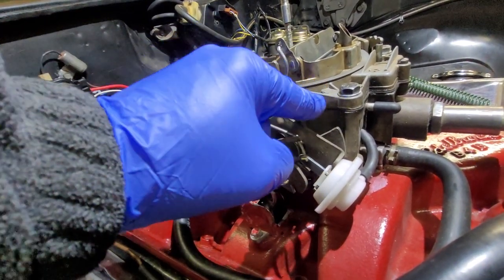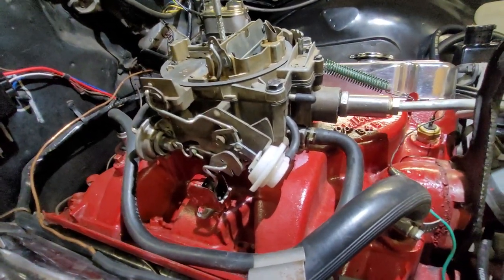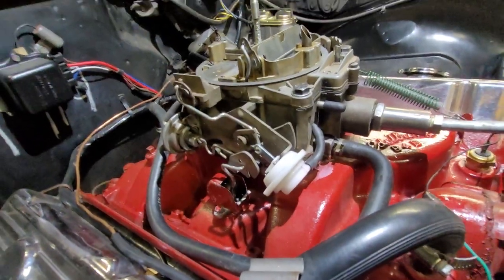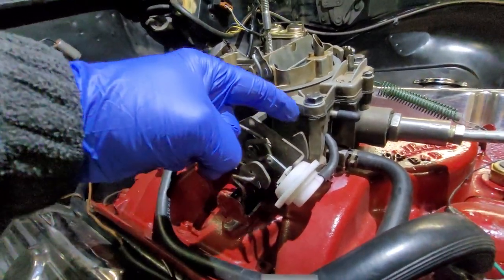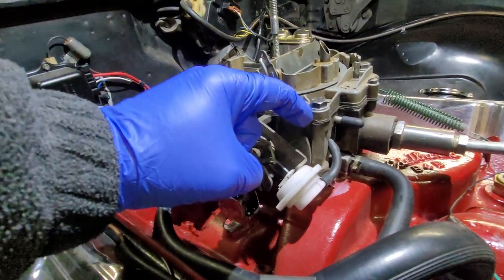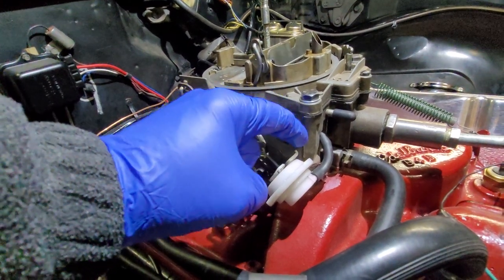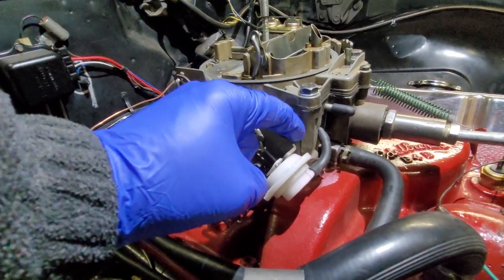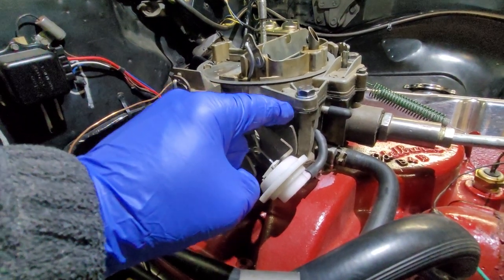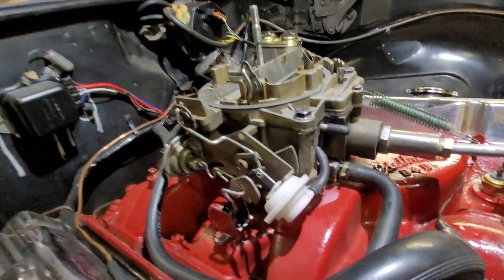goes to step number two. And that's where most of your high idle warm-up will come in. And then eventually, and by design, once the spring is relaxed, this will come down to this step down here on the bottom. Okay? By design, gravity takes over, and that will always go down.